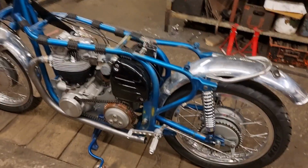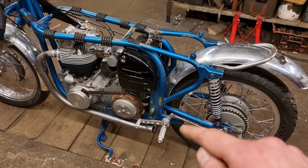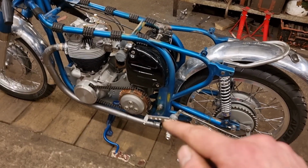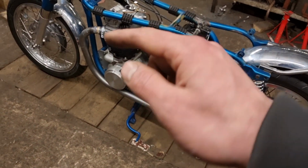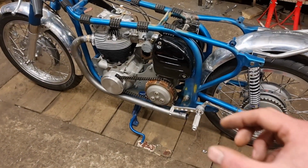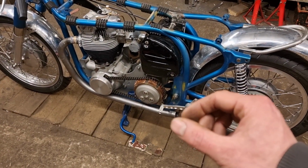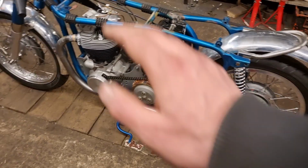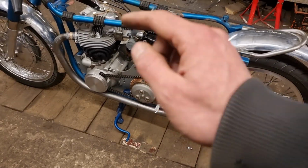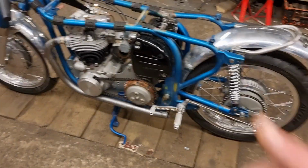It's finished, done. And what you do then, crank that, really tighten that one up so they're in place. And then probably crank that head bolt up, so that's fastened in place. And then finally fasten up the pinch bolt in the middle. So that's tight, and then clamp it. Don't do the front to the back or the back to the front. Do the back, then the front, and then the middle.